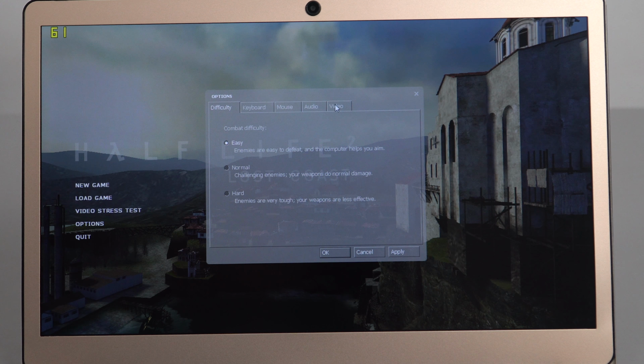Okay, so that one got 55.6. That's with 6 watts. Let's try it now with 15 watts. So amazing results here. Look at this, 98, almost 99 frames per second. That's even faster than the Intel HD 505 with the 18 execution units or whatever they call them on the GPU. So that is an, I don't know, approximate 75, 80% boost in frames per second, which is just amazing. So let's have a look at the temperatures to make sure it's not cooking itself.